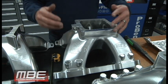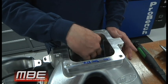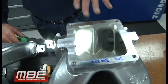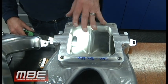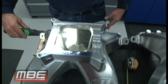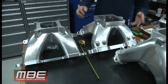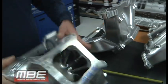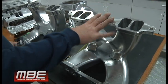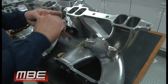The dimensions on the drag race application are significantly larger, and we can show those. Because the engine sizes are almost identical — probably a 440 and a 440 — the difference is really the RPM range and the application. On the cylinder head port side, not every port is created equal. The runner going to the 4150 has a much smaller cross-sectional area to help it run at that 3,400 RPM.